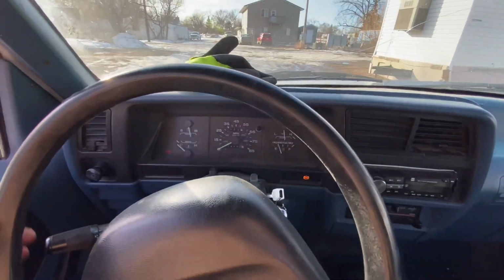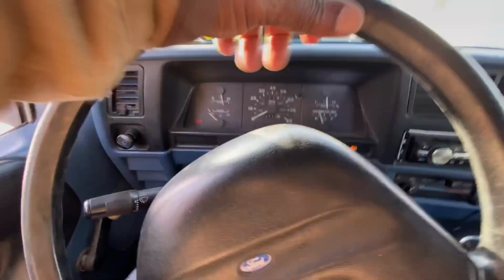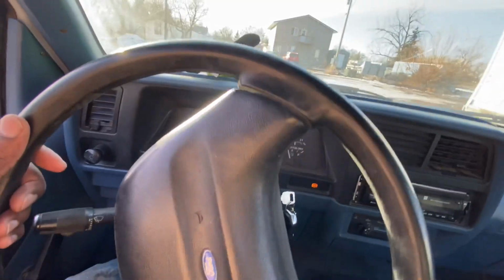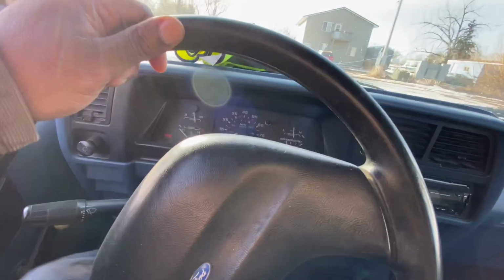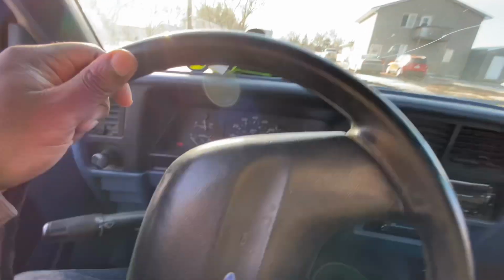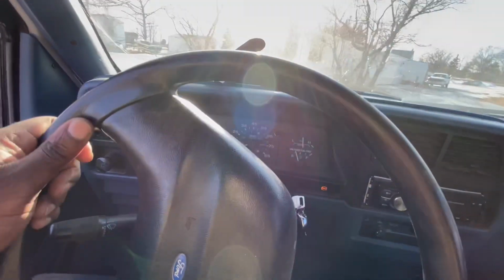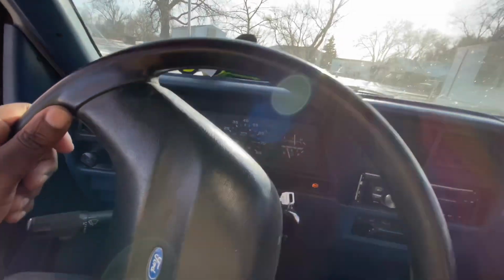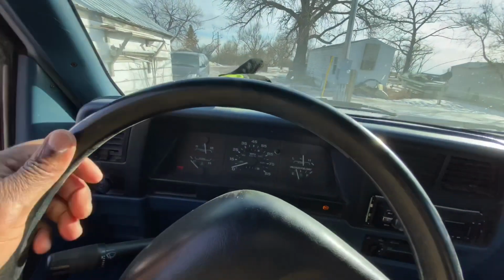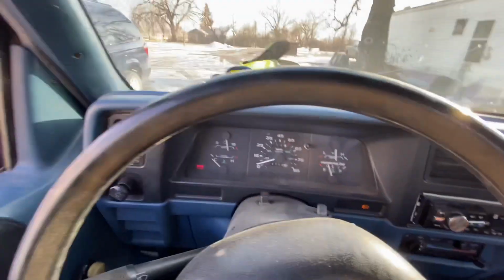And just a point of correction, this is the initial video when I replaced the DOT 3 fluid. Later in the day, after I did this replacement, it failed, so I did a second one. I gave it like 2 days, then I used the hydraulic jack fluid with the stop leak and conditioner, and that's what the key was, and that's what enabled me to have the clutch working without any issue.